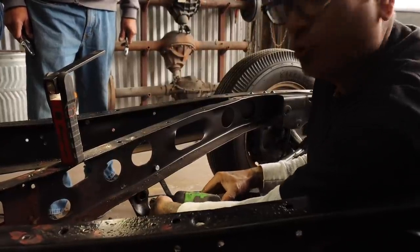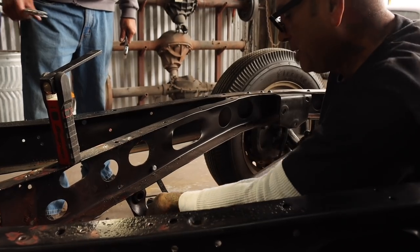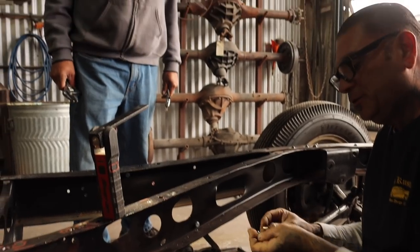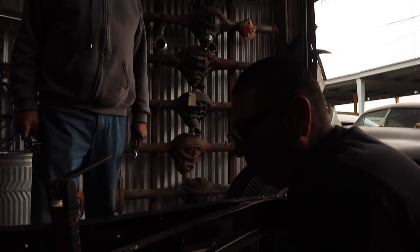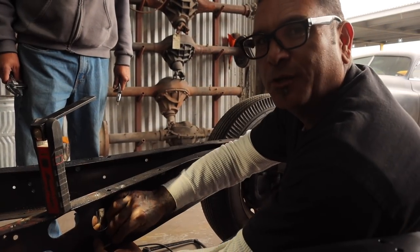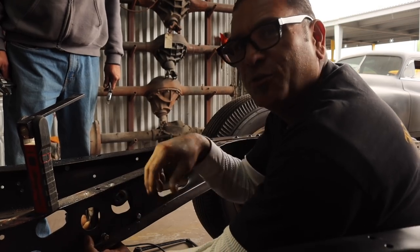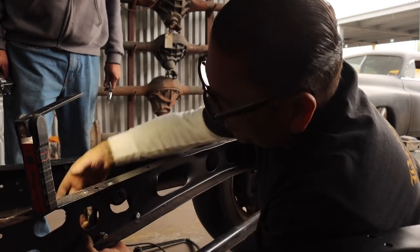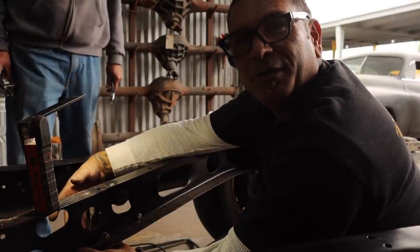It's a 39 Ford pedal. So your 34 has got the cable brakes? Yeah, 1936 to 38 had cable mechanical brakes. The hydraulic, and we're gonna put hydraulic brakes on this. It works better? Yeah, it has a hydraulic pedal. So you mount a hydraulic master cylinder here, and the other ones don't because they're made for mechanical.